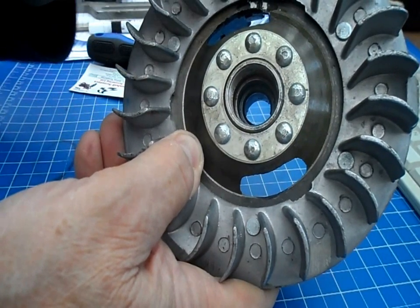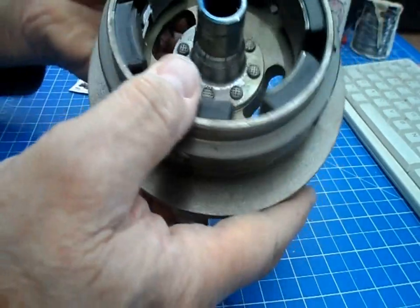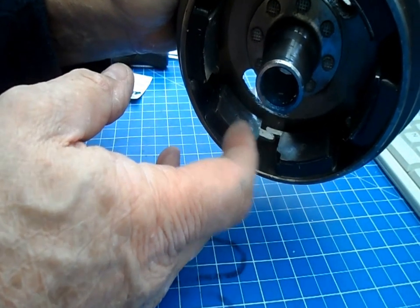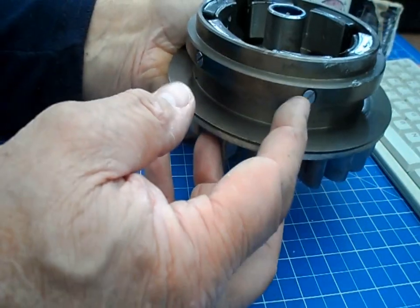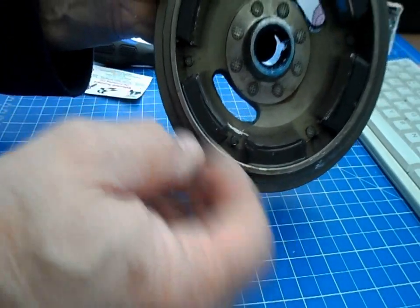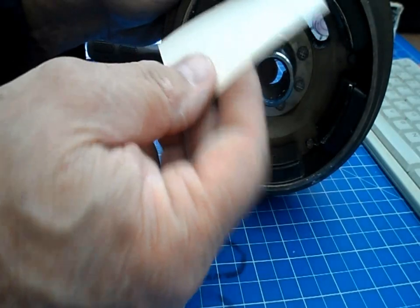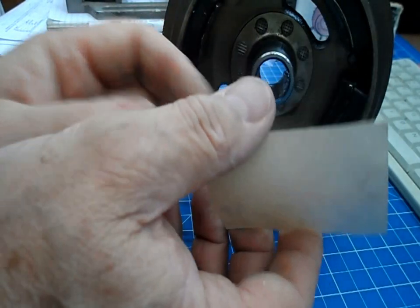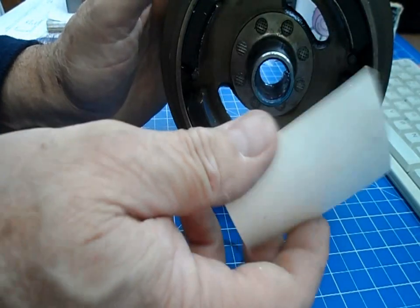The ideal solution is probably going to be to put an external pickup on - I'm sure that's what I'll end up doing. But in the meantime, just as an experiment, I'm going to space the two magnets that have the fingers on, as you can see there, by loosening off the screws that hold the magnets in. I've loosened those off and I'm going to pad them underneath. The card thickness is around about three thousandths of an inch - I'll put this behind the magnets to lift them closer to the pickup and see if I get a spark.